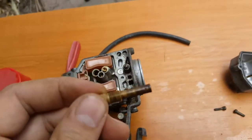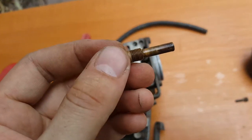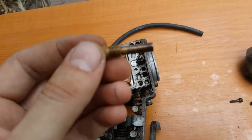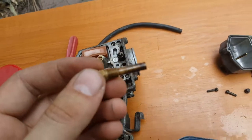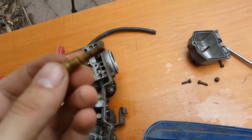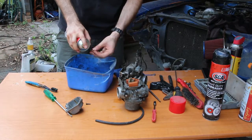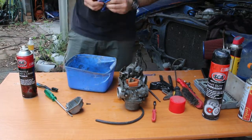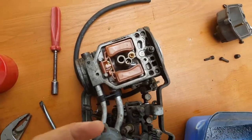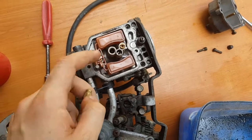Important thing with these is don't use pins or anything like that to clean out the jets. Just try and get it out with solvents or cleaning fluids, and if need be you can boil them, which works as well. I've also sprayed a bit of carb cleaner down in there and will just wait until it comes back out clean, because there's a bit of gunk in that as well.